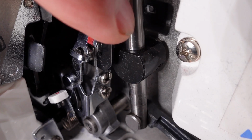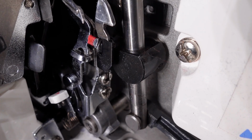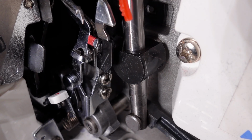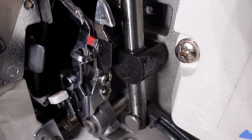This shaft here. And that tells you that the shaft there is seized in that bearing there. And I just about guarantee if I work away on that bearing, maybe just apply a small amount of heat and a little bit of penetrating oil, that might free up. So let's try that. First of all, we'll get some penetrating oil on there. Just give that a quick spray there. Okay, and we can work away at that.